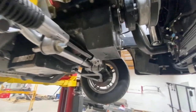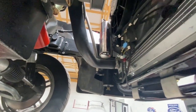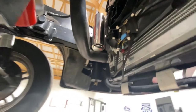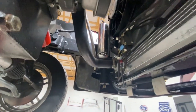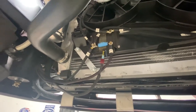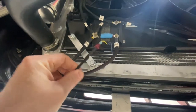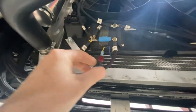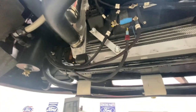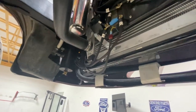The other thing I'm going to do involves my fan controller — it's an old DC controller. Right now I don't have the jumper, but I've had a jumper on these pins which basically just runs the fan full out all the time as soon as the key comes on, because I lost my little temperature probe. I'm going to control all that with the Holley instead — I'll do another video on setting that up. Basically I'll just be controlling this trigger wire from the Holley, like a relay trigger. For right now the fan is disabled, which takes a lot of load off the starter. Between those two things, significantly better cranking.